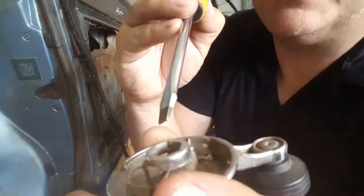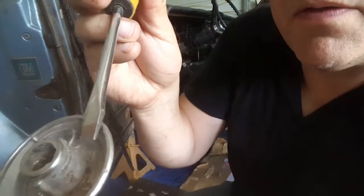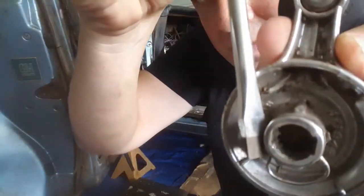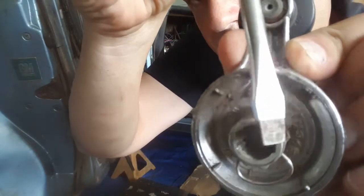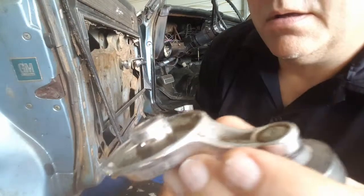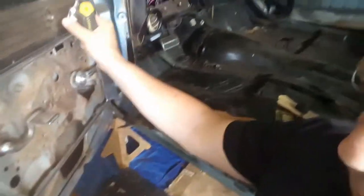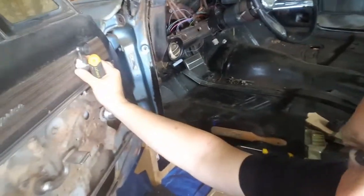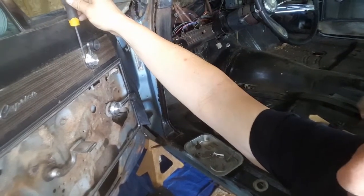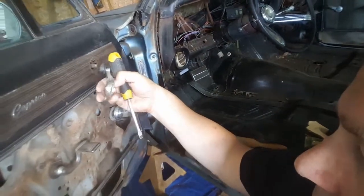What you're going to do is take these ends — right there — and push them down. So if this is sticking up in this position, this is how it is — you're going to knock it out down, both of them. When it comes out, you'll be able to pull the door handle right off. When this was on here in the upward position, put it down, both of them. You can use two flat blade screwdrivers at the same time, or one of those tools, and it'll pop those clips out of the ledge here and it'll pop off.